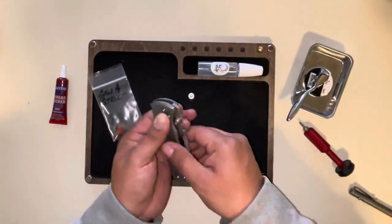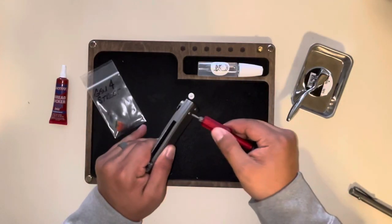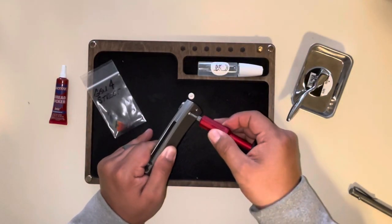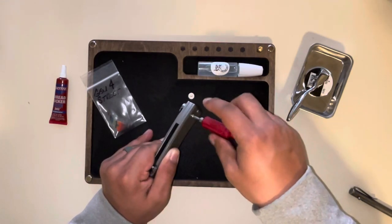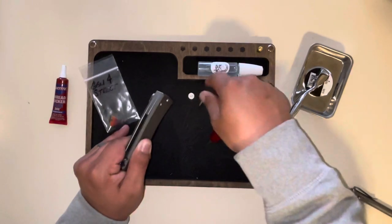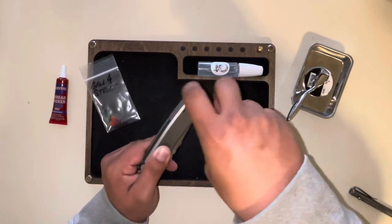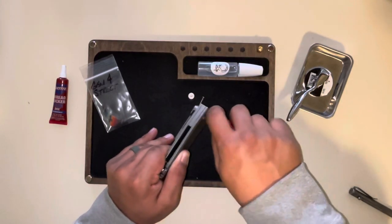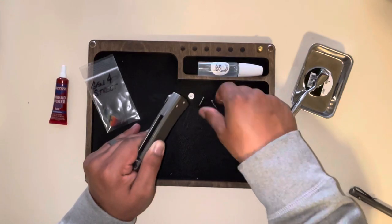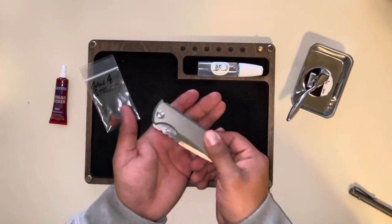So we're taking it off that side. I'm going to continue to pinch it together, and I'm going to continue to take off these secondary screws, and this is all T8, which is another really good design choice, having your main body screws made entirely of T8. That's a good thing. Less likely to strip a screw head and less likely to cross thread because you'll have more purchase.